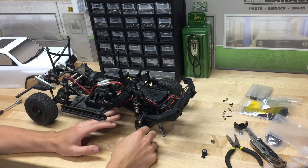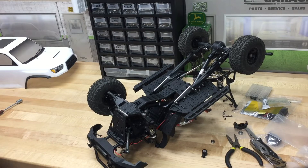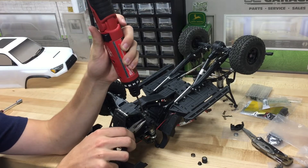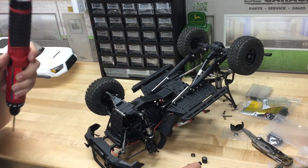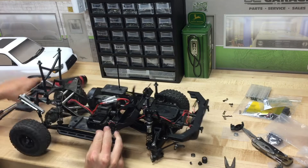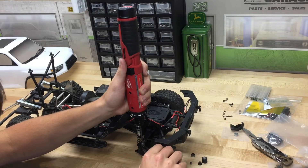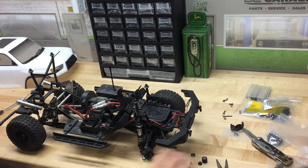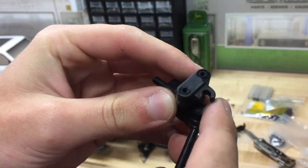With that out of the way, it's probably easiest to flip the truck upside down. We're going to be working with these ball joints here. With it upside down, I can get this bottom one first. We just have a nut, and then we can unscrew it — these ball studs, I guess they are called. Now I'll flip it back over and get this top one. I'll go ahead and show you where my knuckle failed, just right here on the top.